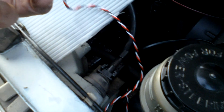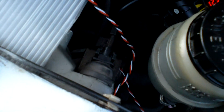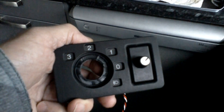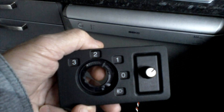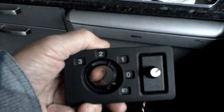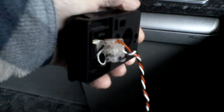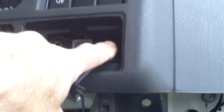Both units are in now, applied to my connector blocks, and the next thing is the wiring and the switch. This is the old control for the rotary knob for the hydraulic, but there's no way I can do anything with it — there's a big hydraulic unit behind there and I cannot adapt it, so I've had to put a rotary control in there. The electronics are just bolted onto the back. Hardest job, believe it or not, was threading the wire through. I've got 6-core cable but 3-core would be sufficient, from the engine bay where it picks up the servos on the headlights to the switch.